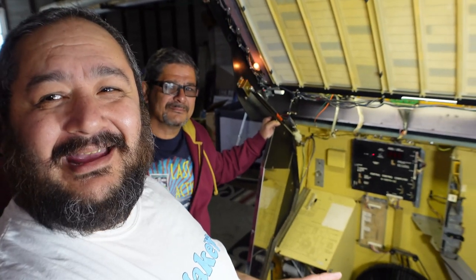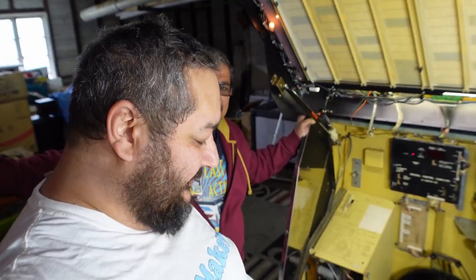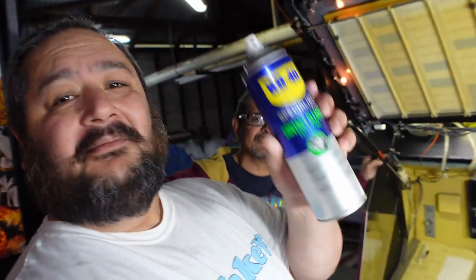Always check your connections and make sure your plugs haven't oxidized or anything like that. You can always use a bit of contact cleaner — we used WD-40 contact cleaner, but there are other brands available at your Jaycar or other shops like Bunnings, which even sells it now. That's how you run through the basics to get your jukebox working again. This is the Rowe AMI R84 jukebox back up and running. You've been watching PropMaker — thanks Rowan!